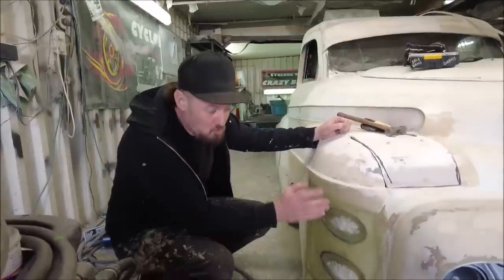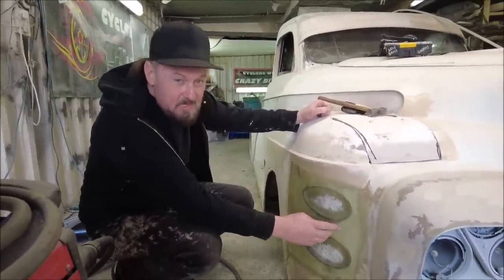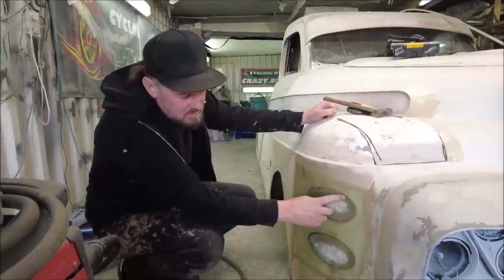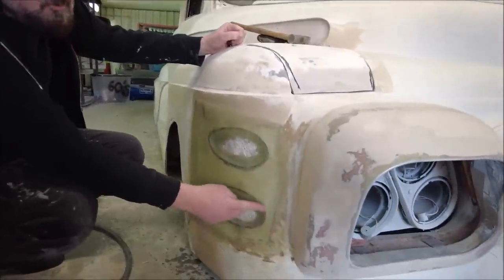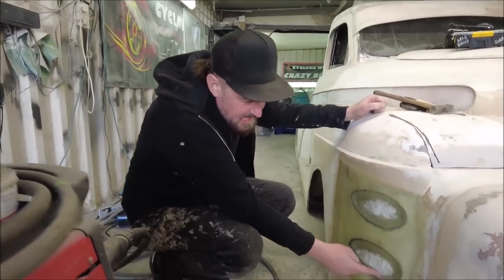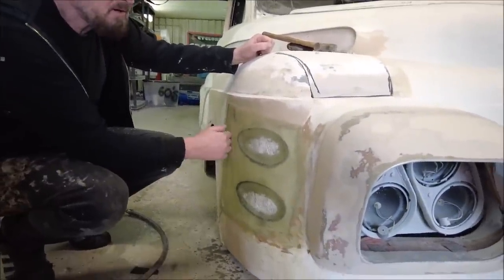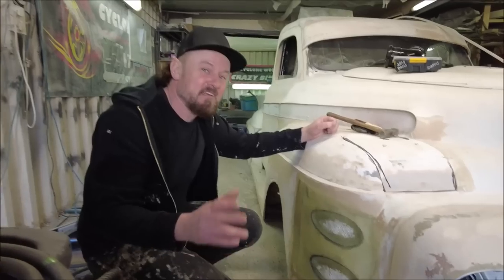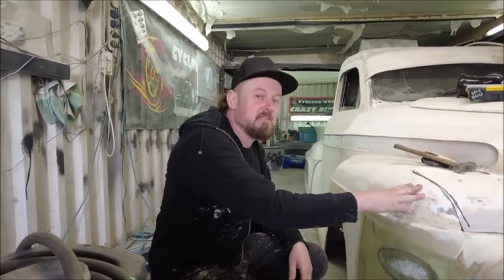The air ducts are all dry now - all the fiberglass is rock solid. Because it's slightly translucent we can see it's stuck to the edge of those pipes really, really well. The next step will be to trim this out, give it a grind, make sure it's all level, and then body-work this into the panel ready for that all-important front wheel spat to fit up to this. Now let's have a look at what hot rod building legend, cheap foos, Lee Cox has been doing.